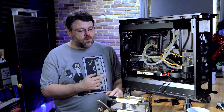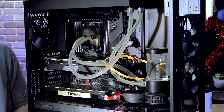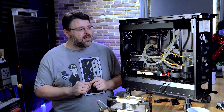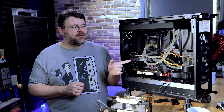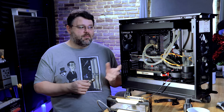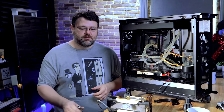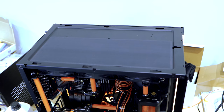A 32-core workstation with modular liquid cooling — it's easier than you think and makes more sense than you think, especially for somebody like me who's changing their system configuration depending on what they're running or what problem they're trying to solve. I've got a custom loop with flexible tubing — not as ornery as hardline — but the challenge is cooling the GPU and managing GPU block swaps. If I want to pull the GPU out and put in an air-cooled GPU for testing, is there an answer in water cooling? Well, EK does actually have the answer.